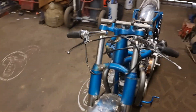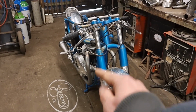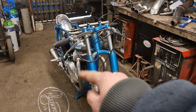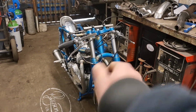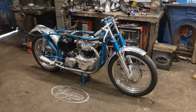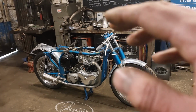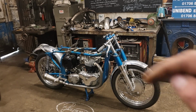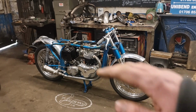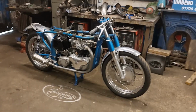That'll be like one of the best sets of dummy pipes you've seen probably. Not as nice as my race set, because with my race set, what I do is I just flick that in. But it adds like another 70 quid onto the job. It'd be 150 quid just to flick them in at the tops, because I have to get that pipe, fill it up with sand, and then twist it in and then back out again, make them into swan necks on the front, and it neatens it up a lot, but it adds a lot of expense to the job. Whereas that's exactly the same looking system as I did on Brian's Dominator Caferacer, but it's just missing out that little tiny bit, which is, if you've got a lot of money in your pocket, you can pay for that little tiny bit, but this looks exactly the same. That's a replica of his, but his is a full works system. This is like a Caferacer system, so you don't want to go to that full extent.